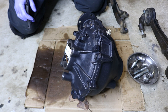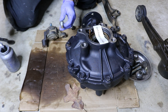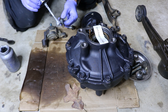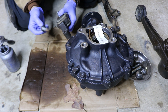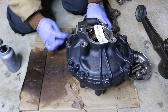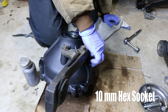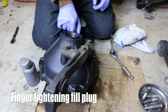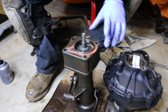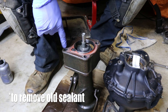I'm going to reassemble all the piece parts onto this new diff and torque everything at the end once everything's assembled. I'll be reassembling these bolts with just a tiny bit of anti-seize — seized bolts are very tough to deal with, so a tiny bit of anti-seize will prevent that in the future if I have to do disassembly. Now here at the axle housing, I'm going to clean up these surfaces with a razor blade and then clean up that area with some acetone.